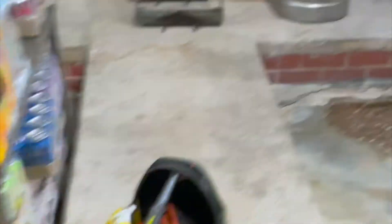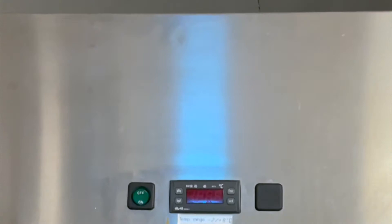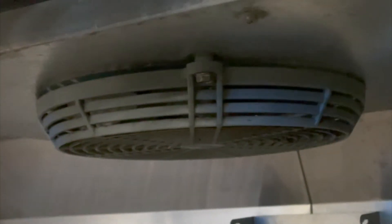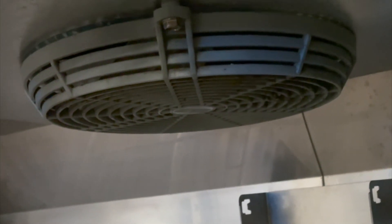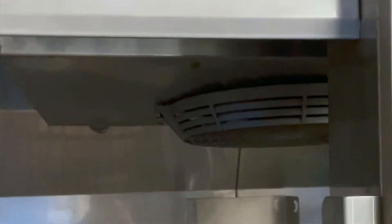Our final job of the day is to repair the fan inside this fridge — another type of job we do. Having had a look at it, it turns out it was just a faulty fan. The fan had jammed itself up and the motor corroded, so the whole thing was just tripping off the RCD. We've had a quick once-over, we've got the parts now, so hopefully we'll be able to get that swapped over.